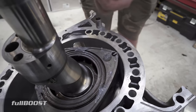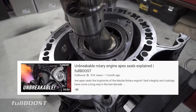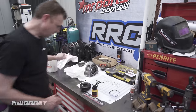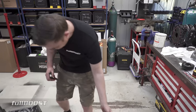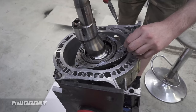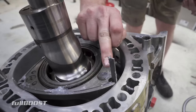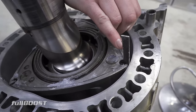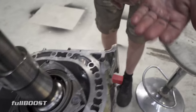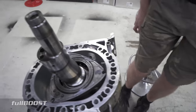These are the PowerSeal springy type corner seals — they don't require the factory style little rubber pieces in them. So if you're looking and going 'oh, you've forgotten the little rubbers' — no, they're not required. What I'll do now is take the apex seal out. They'll come out pretty easily because there's no tension on them. Now it's just a case of assembling the springs. There's a step just here and another step up the top here — so there are two springs: one that sits on the inside of the apex seal and one on the outside.